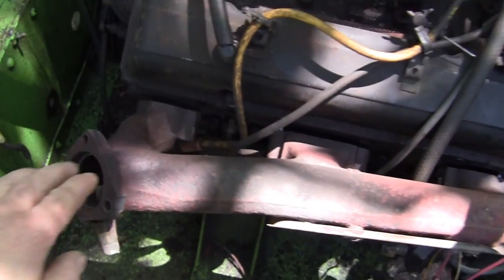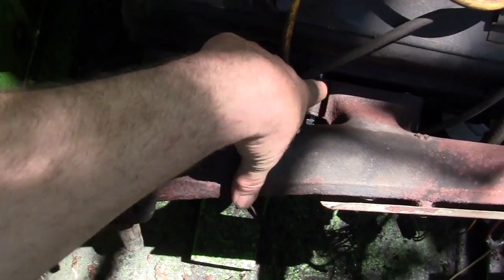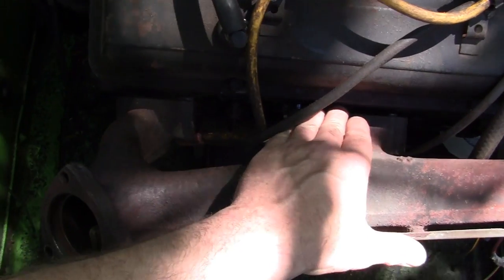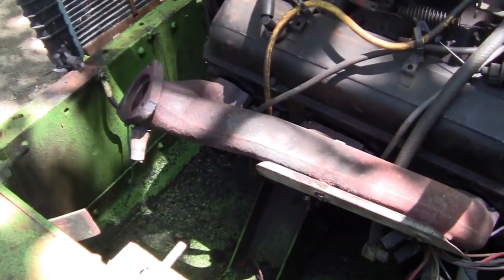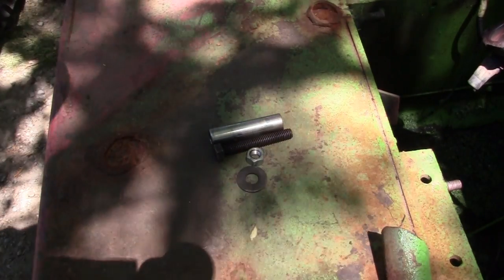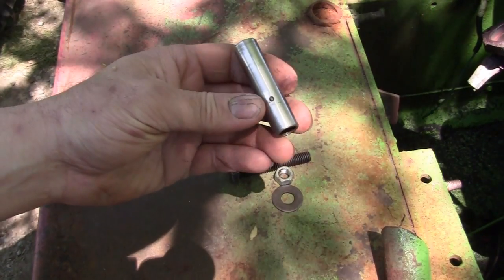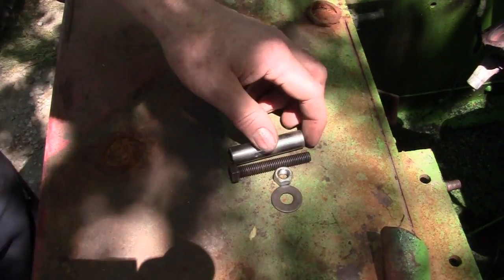What's going to happen is I'm going to put it in between these two. You can either use a spreader to push this apart or you can drill your holes out bigger in your exhaust manifold. But I prefer to use a spreader because sometimes when you drill them they don't exactly cover right where it's supposed to. You're going to need four pieces: a flat washer, a 3/8 nut, a hardened 3/8 bolt, and this here is a brake caliper slider — it's part of a GM slider pin, some of you may recognize that.